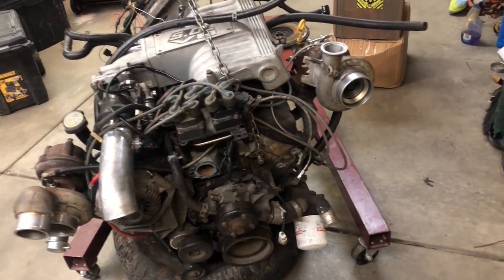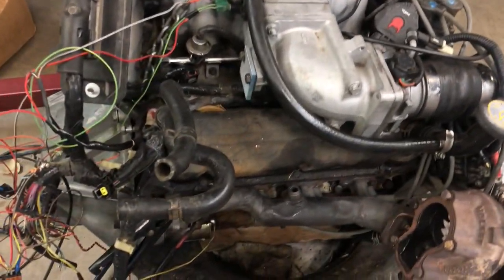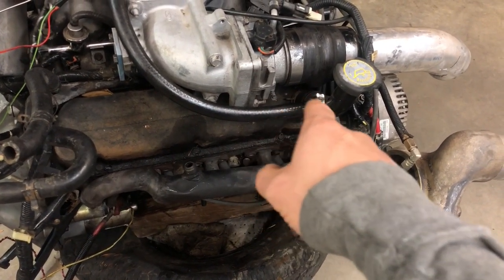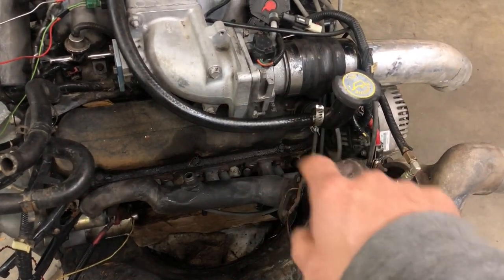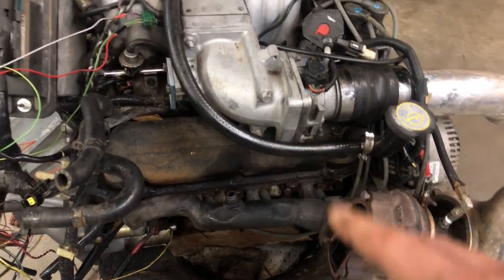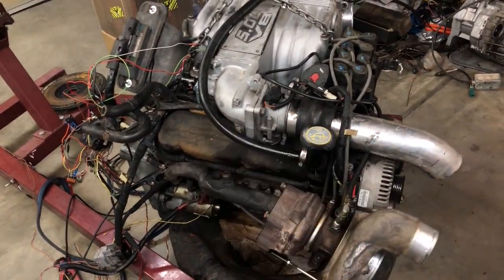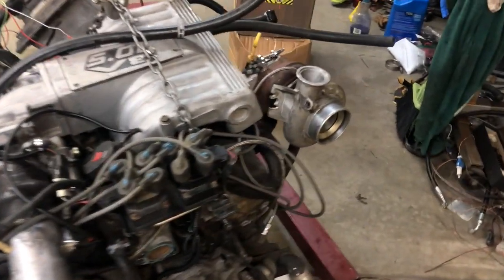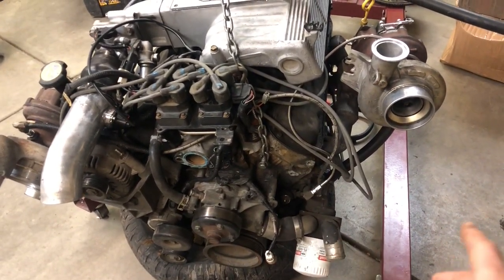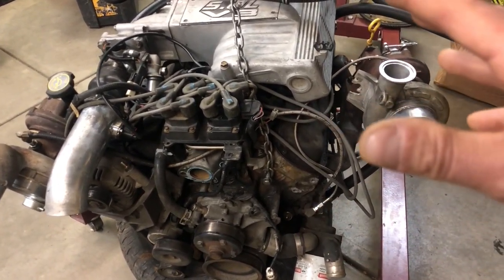It did blow up on me once. I had to replace all of the gaskets and seals, as well as the rod and main bearings, because a head gasket on the passenger side blew between the coolant and the oil return passage — it just pumped coolant into the oil pan. I dynoed it like that and had no idea until it started smoking and I pulled the dipstick. The dipstick was to the top with milky oil. I did a very quick budget repair — reused the stock torque-to-yield head bolts, did not re-ring it, did not hone it, just put in bearings, gaskets, and seals, bolted it back together expecting it to blow up. And it still hasn't blown up.